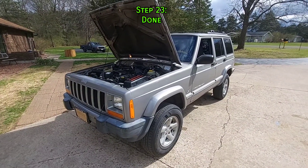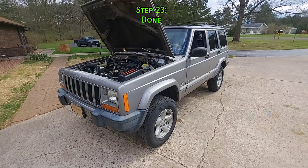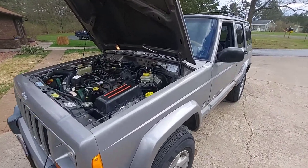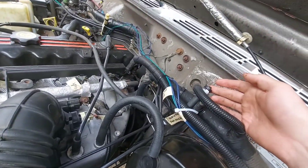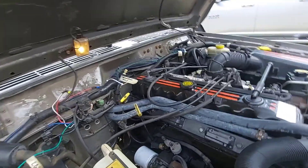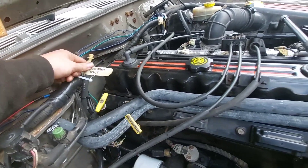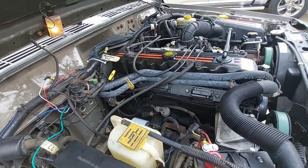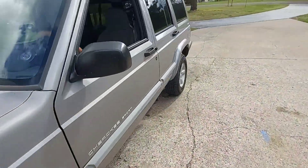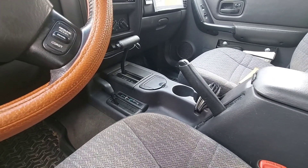I didn't script this part because I never thought I'd get this far, but that's how you replace a transmission — it's a pretty rewarding feeling. I rerouted the transfer case vent hose up here right next to the front differential breather hose, so it's much higher than it would otherwise be. The transmission vent hose is at the same height over here. You can buy these little end fittings on RockAuto — I have those linked in the description. Also, after putting in a transmission, try to start it in park and neutral. This one does not start in neutral, which means I need to adjust the neutral safety switch.